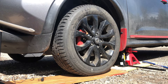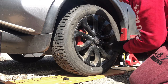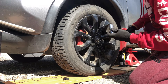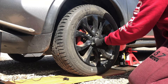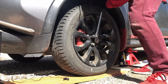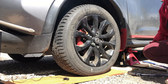Now we're going to check the control arm as well as the ball joint of the car, but first we need to remove the tire since the control arm is located behind it. Remove the lug nuts using a 21-millimeter socket and a breaker bar to give us better leverage. Note: you need to loosen those lug nuts while the tire is still on the ground to prevent it from rotating.